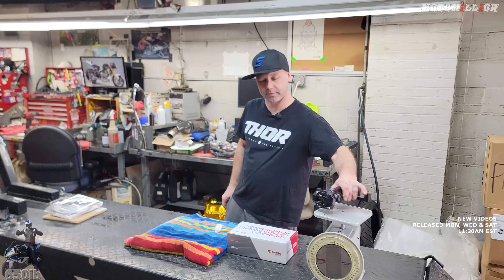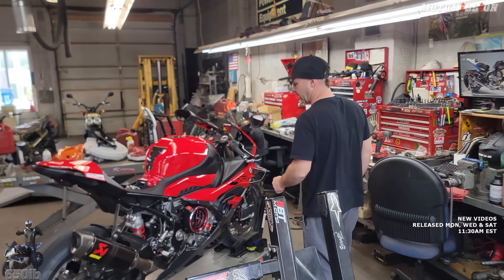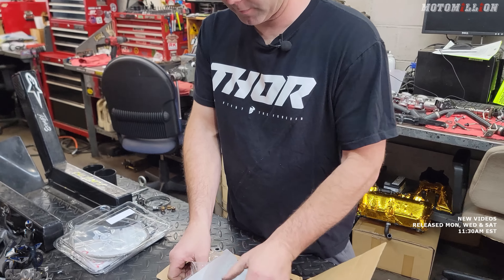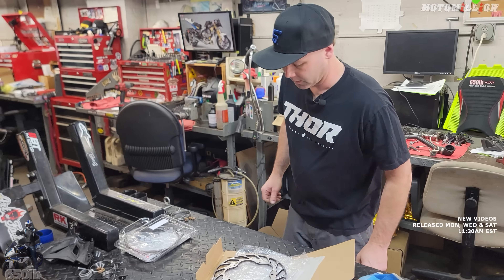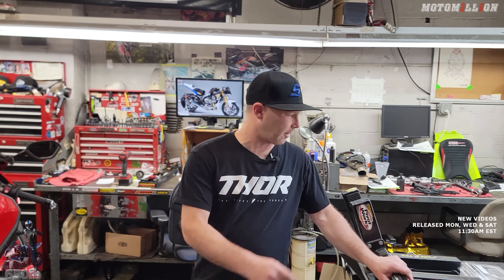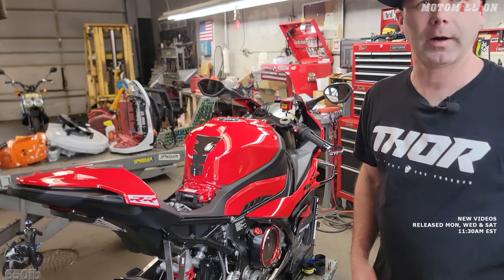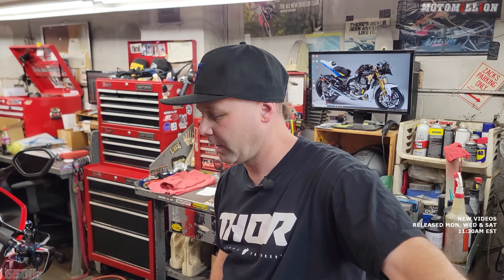The stock setup is about the same—probably going to be three pounds, maybe. Good guess. We also got an M&M Racing rotor that we always use. We'll have to pull the wheel off. That's the stock rotor, so it should fit. We need to drain the brake system just like we did in the front, and we'll have to hook up a new brake line because the brake line needs to be a lot longer to get to that caliper. There's one modification we have to make to the top of the ABS box to get that brake line to work, because they still don't have the factory bend.